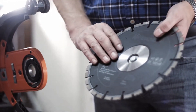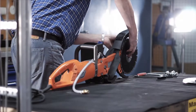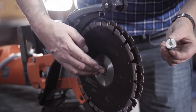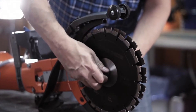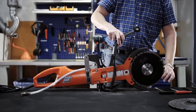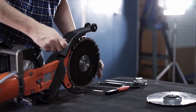Insert the bolt, then fit the new blades on the bar. Align the pins in the washer with the holes in the nut. Use the combination tool to tighten the center bolt. Tighten it gently and rotate the blades to make sure the belt doesn't get clamped. Repeat this procedure and tighten the bolt harder every time.